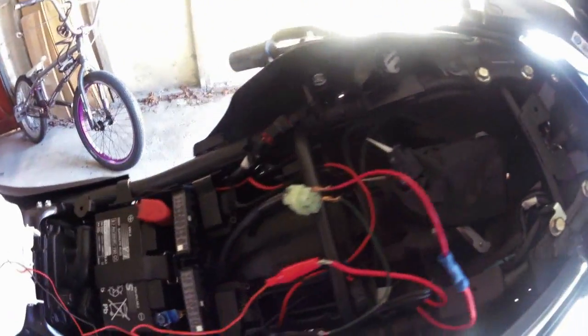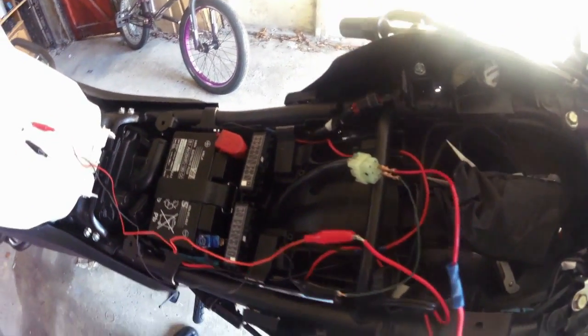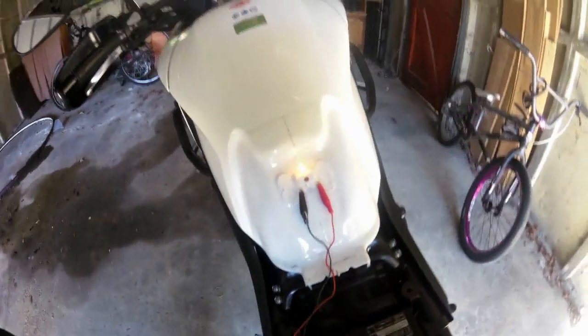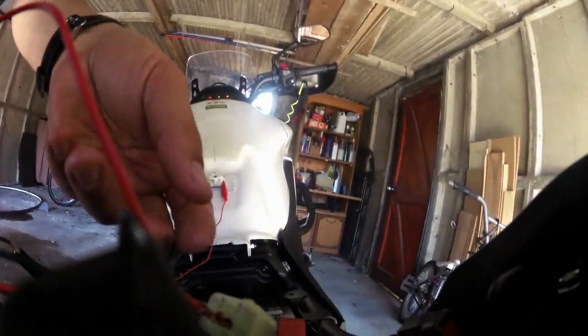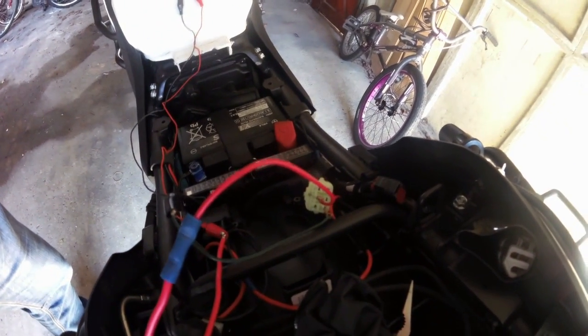Let me just test something, because I know that these relate to indicators and things like that. Put that in there - it's not on. That's interesting. Right, indicator. That's the orange - it's only a circuit when it's on. Doesn't work for the left indicator. Let's see if I can find it. Okay, that was left indicator - that's right indicator now. So the purple seems to be probably the headlight. The two others that are live and switched are your right and left indicators, and there's only power going through them when you're indicating.